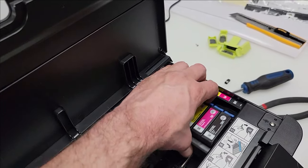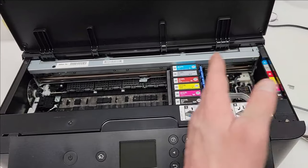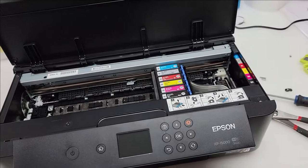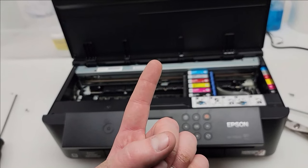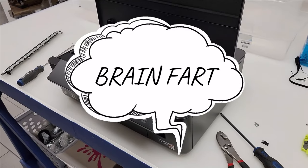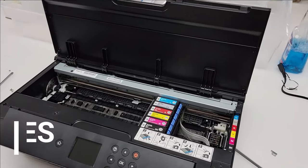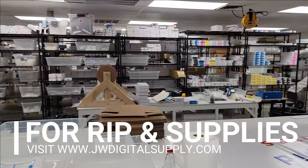And there you go — you've now converted the printer and it is ready to go. Since the printhead is undocked, I recommend plugging it back in and powering it up, then move the printhead out a little bit and it'll rehome itself and lock itself up. The final steps would be to install the chipless firmware, which I'm not going to go into in this video, and also to get yourself a good quality RIP so that you can process your images for direct-to-film printing. And there we go — that's it for today.